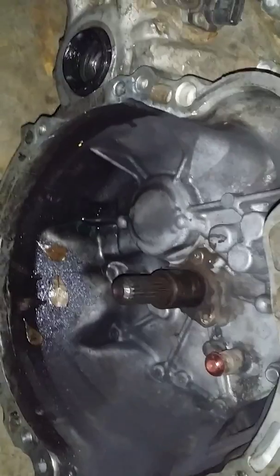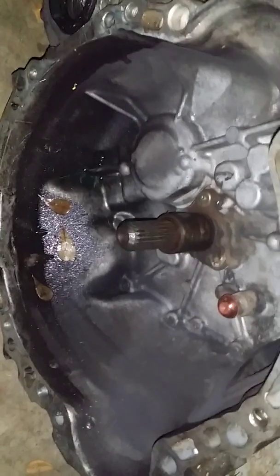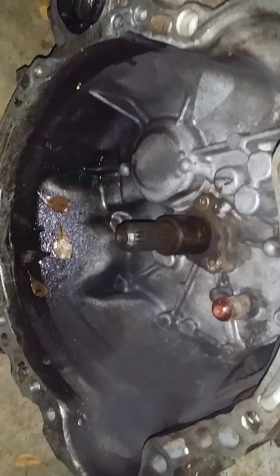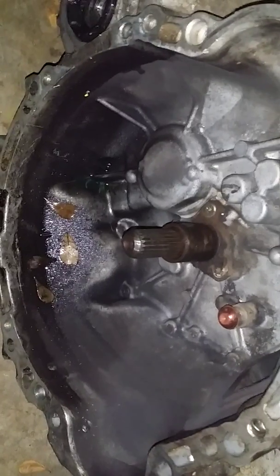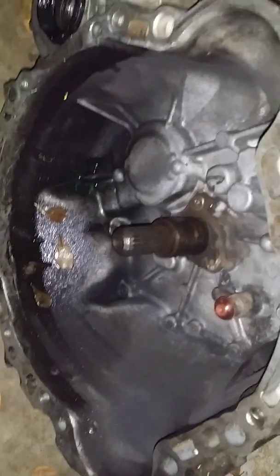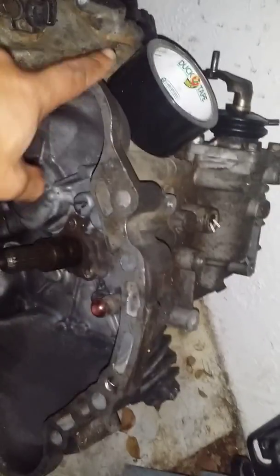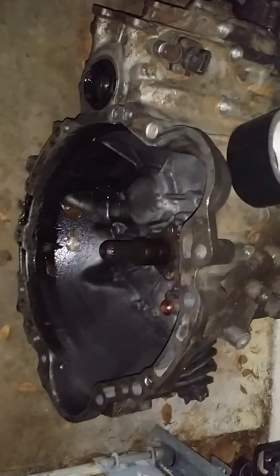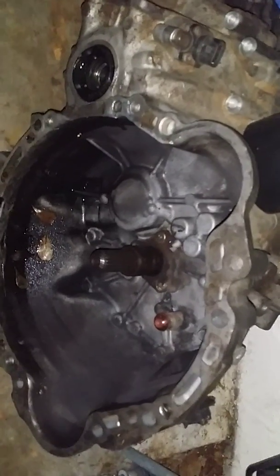So you can go to your local clutch place or send the specs to a custom place that can make it for you and ship it back to your house. That will save you a big headache, and then you don't have to worry. But remember, it has to be an '11 transmission, E51 or E58, because the bolts are different on the MR2 ones. Even though they look the same, the bolt pattern is different. So do that and you'll cut out all that sourcing and searching around the globe for this and that. Just get a custom disc like I did.